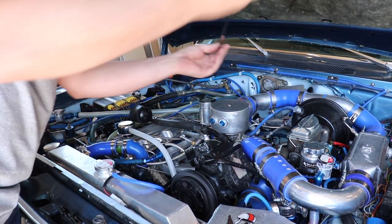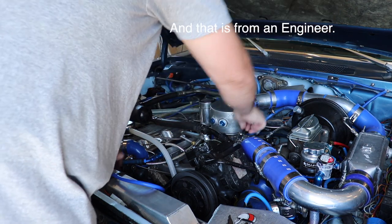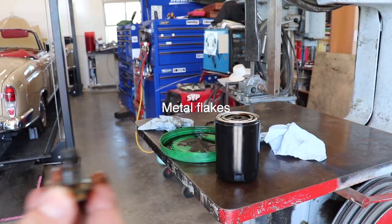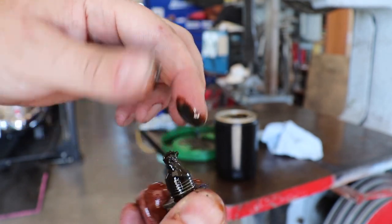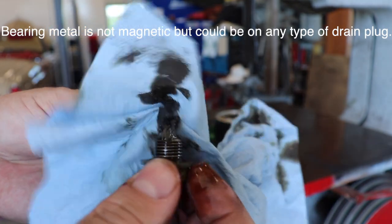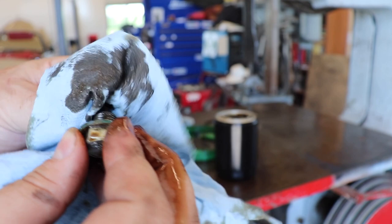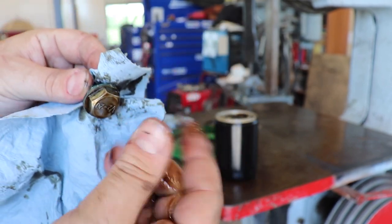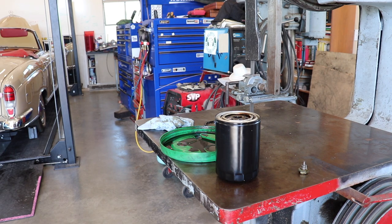When looking for an oil issue in an engine like this, with so much stuff on the car it's not easy to dig in. Obviously check your dipstick — what does the oil look like, do you see any metal there? Odds are it's already dropped to your crankcase, but still check it and see how it looks and smells. Drain your oil — I'm using a magnetic drain plug, so check for metal filings. I had a fair amount, but not bearing metal — more like very small cast iron shavings, which I figured out later. Still, that's more metal than you should have from a single oil change. Magnets like this are good additions to any car, including one in the radiator, great for catching rusty particles.